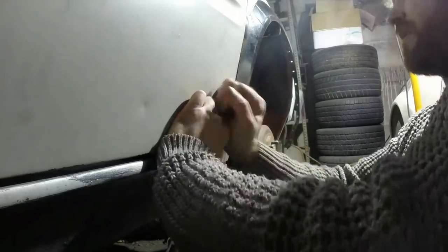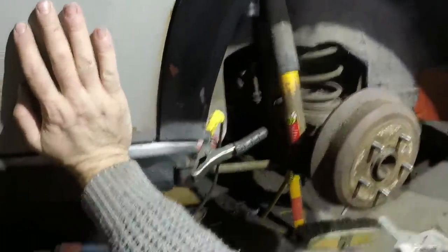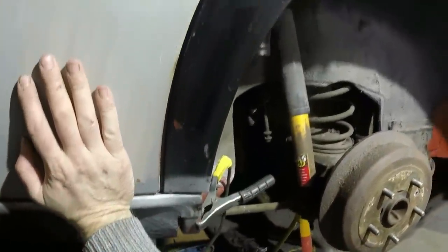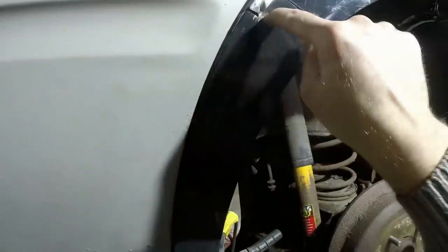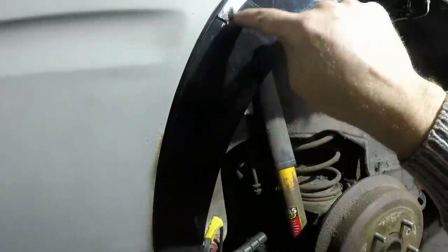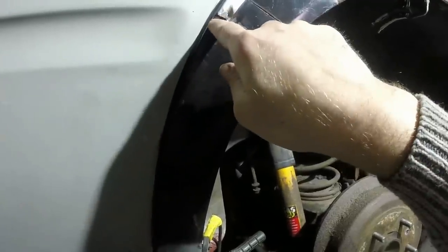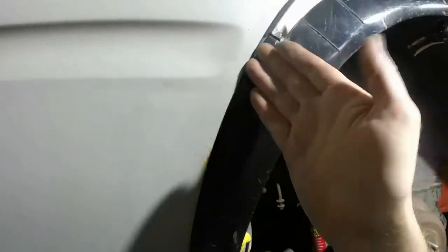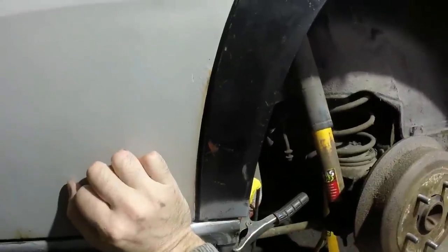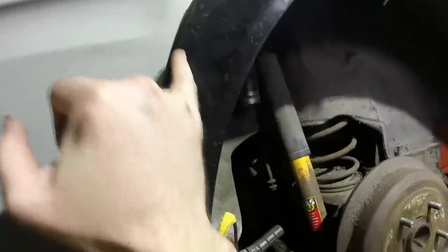Oh, happy motherfucking days. Right, getting somewhere. We have decent gap down there. It's a bit tight there, but I can shape that when the door's off. That I'm going to re-tack because in hindsight it's actually quite good. I'm going to pull that lip out a little bit and then tack that flush. So I'm going to open that door, use the chisel to move this out slightly, tack it, put the door closed again and try and move that bit back.